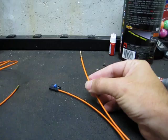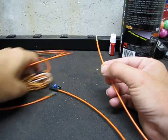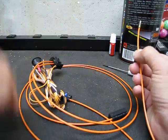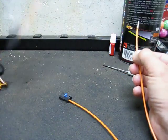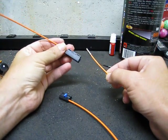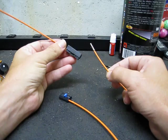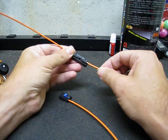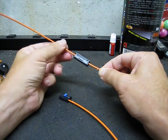You're going to take this bare connection that's already in the car. Now you're going to have the fiber connection with the harness that came with the i-tronic. You'll notice on this connection there is an inline connector already mounted to the output side of the i-tronic. You're going to take this connection, insert it in until it clicks, hear it click, and then snap it shut.